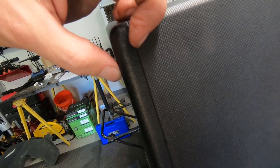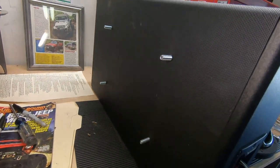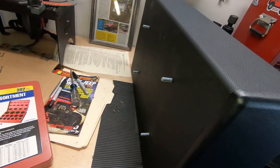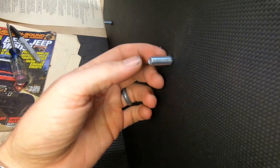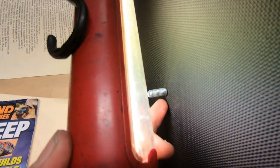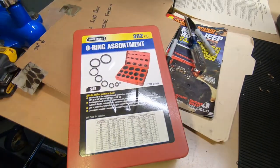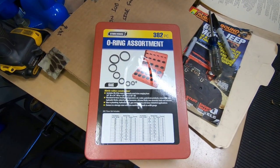The front of the box has to be at least an inch thick where you mount this up, and the rest of it is maybe half inch, five-eighths. The way I'm going to mount it: I drill four holes in the back with 5/16-18 bolts, and I put a little O-ring at the base of each bolt. They fit in there pretty snugly, but just in case it wallows out over time it'll stop the bolts from falling back in if I want to pull it out later. All I used was an O-ring assortment from Harbor Freight — quarter-inch O-rings.